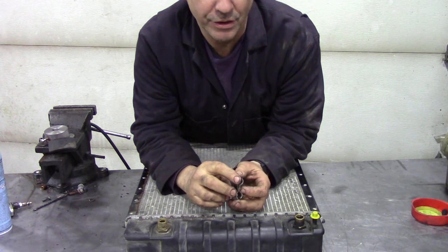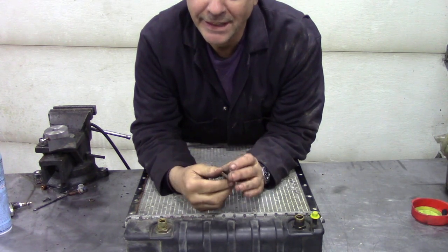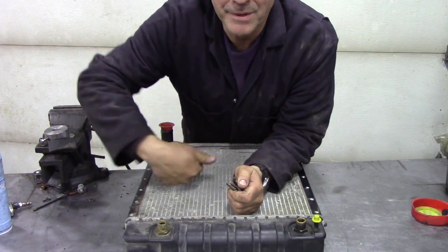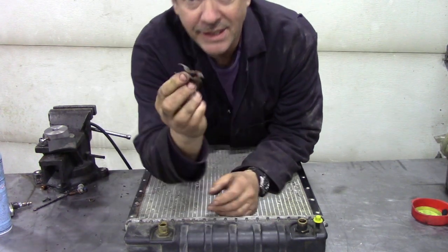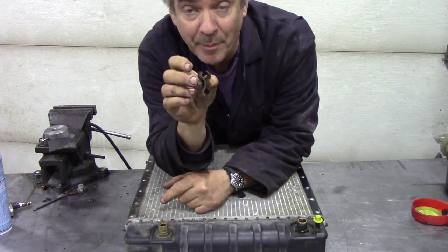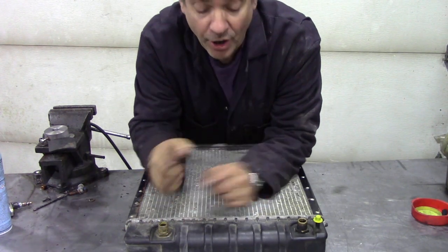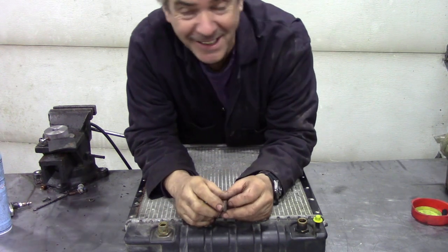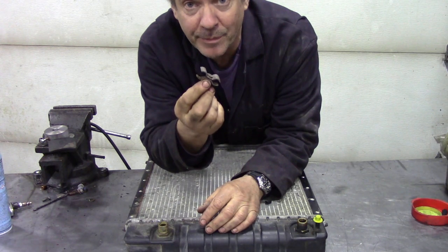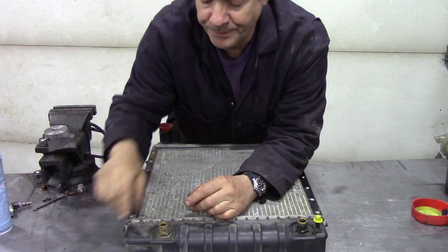And then you get oil into your water, but not water into your oil. People jump up and think the head gasket's going — not really. The reason is you've got higher oil pressure going through here than water pressure, so the water can't go that way but oil can come this way. So this little bracket here — if you can imagine your pipes coming up here — this is a little clamp that holds them together and will help stop that resonation. This will stop a lot of problems, just a tiny clamp. You can see there it holds the pipes together.